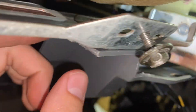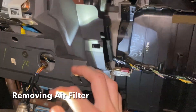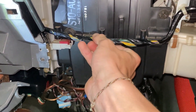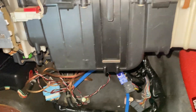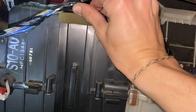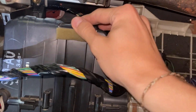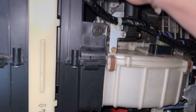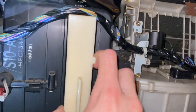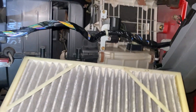If you're just going to remove the air filter and not doing any of this, just pop this wiring harness out of these two clips and you'll have to slide it over. You might have to tug it a little bit and slide it over this piece right here. This unclips from the top, unclips from the bottom. This will drop down and you just have to slide the air filter out. I'll put some before and after photos — I vacuumed this out the other day.